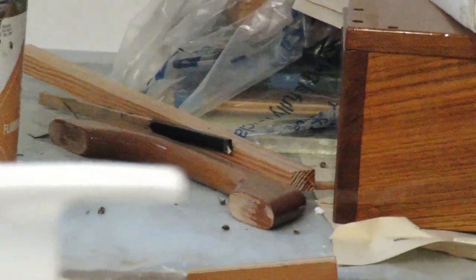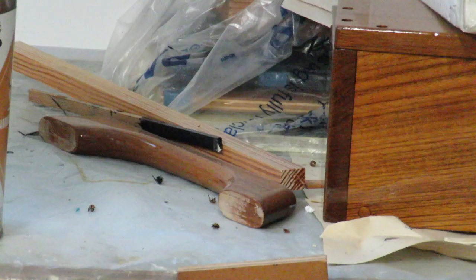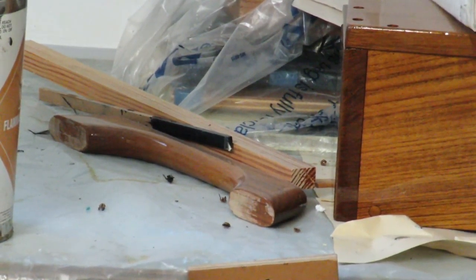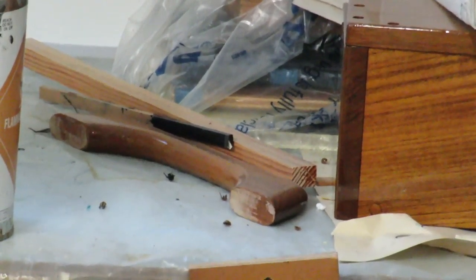Yeah. And I also got a bit of a sag right before I got to the drake tail on the other side. See if that shows up. It's just an accumulation right along the edge of the bottom there. Do your rudder at the same time, so it all matches. Where's this sag? There, now you can just barely make out that sag. Although you really want to avoid sags like that, this is going to be wet sanded and then buffed. So we'll wet sand that sag out.